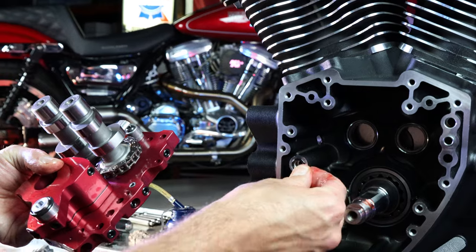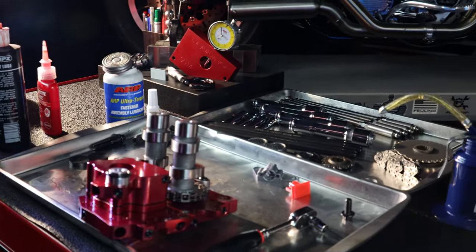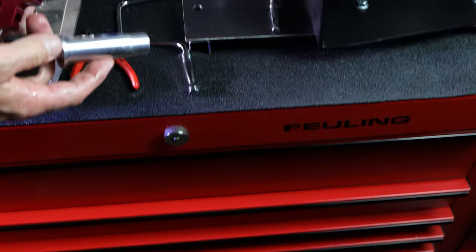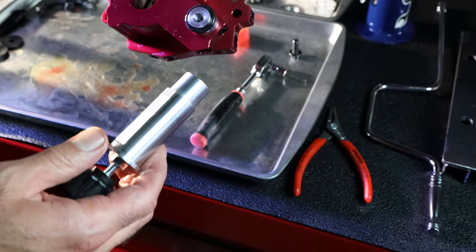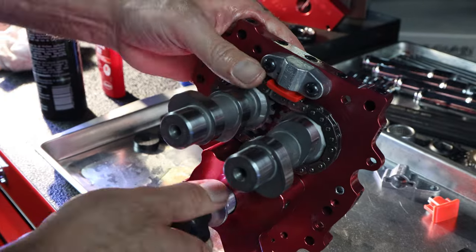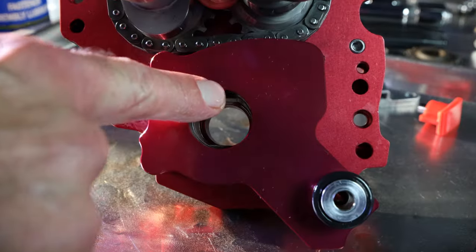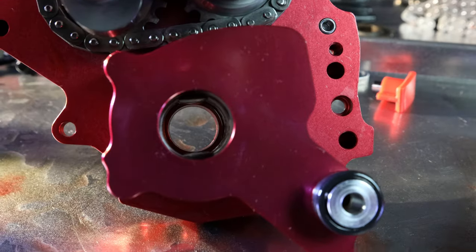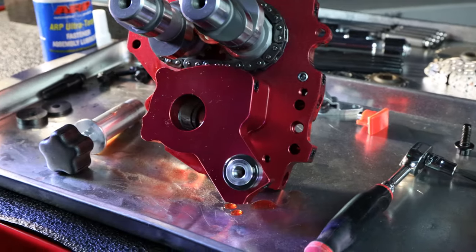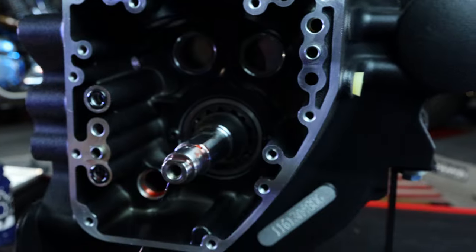We did use the plug and the cam plate here, and we're also going to o-ring it. Now that we've got it as a complete assembly, the important thing we have to do is line up the flats of the oil pump gears with the flats on the crankshaft. We have a new tool for this — we call it the 9017. We're going to slide it in, and you can see our flats are lined up. We're already starting to pump some oil, so we should be a good match to the engine case.